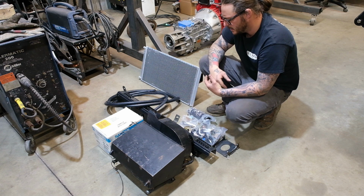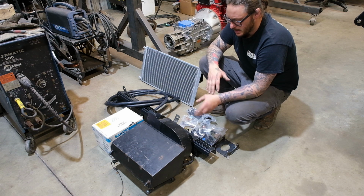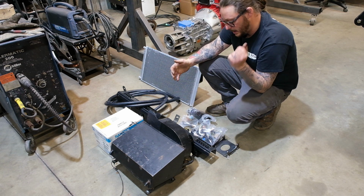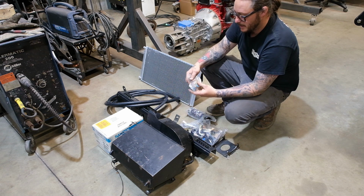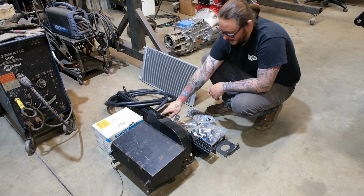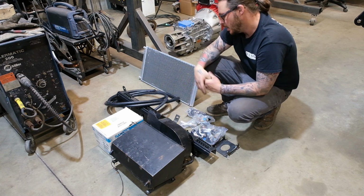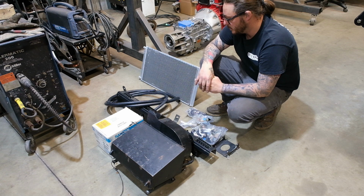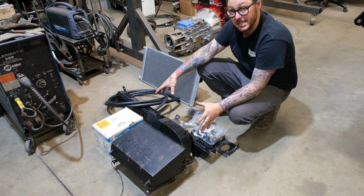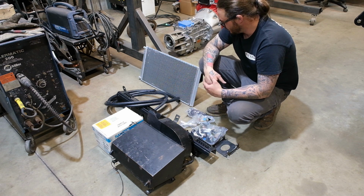There are a lot of times issues that you run into reusing these factory units. The evaporator is usually pretty filthy. The expansion valve needs to be changed, which we do have one of those. That's a must. The rheostat knobs on the underdash unit are a little finicky and flaky, so there are some absolute benefits of going to just a completely new system. But again, I've parted out a bunch of Scouts and we have several of these in the shed, so we're gonna use what we've got.